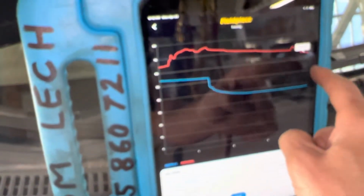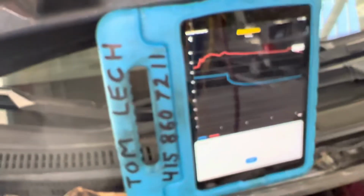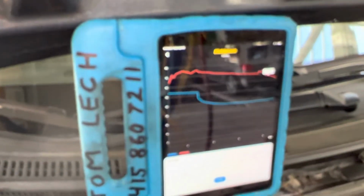To take the cabin air temperature, that's the heat load going over the evaporator. It sucks in the air from down here, where there's a vent down there. So I'm going to put the probe there, and we're going to get the true TD of the cabin, how cold it is in the cabin. You see this temperature starting to come down now. This is the temperature of the air at the probe I stuck down by where your feet go, where it sucks the air in to the evaporator right now.